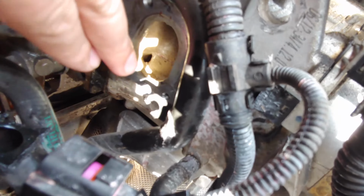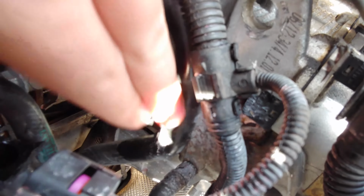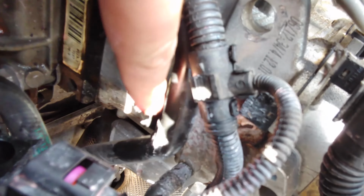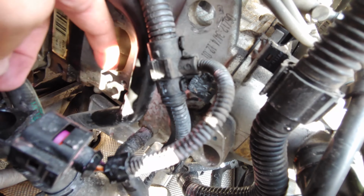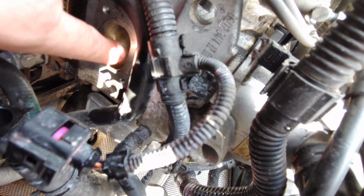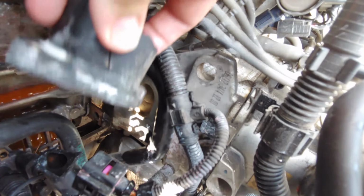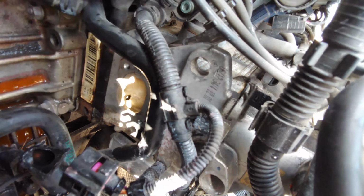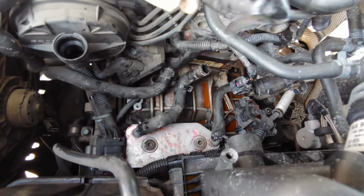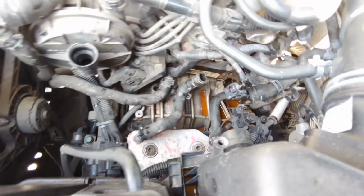So we just got the second bolt off. This guy right here, this is a hose. If you can just tug this up out of the way, there's a little slot, but there's a bolt behind here and a bolt behind here. You got to get that off, and then this junction that we're replacing comes off. And so we're just pulling these broken plastic connectors out. Boom. And any of these can fail.